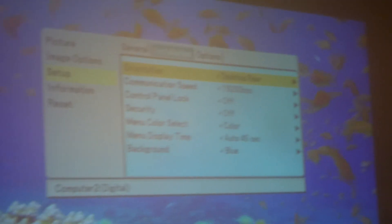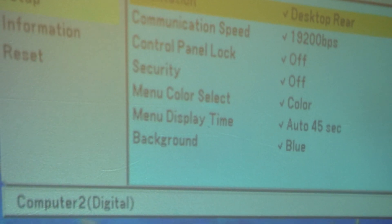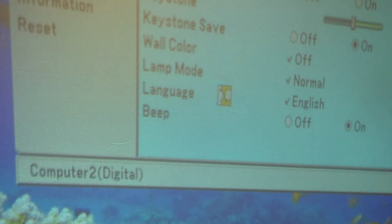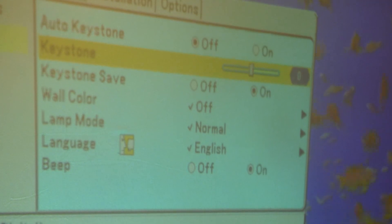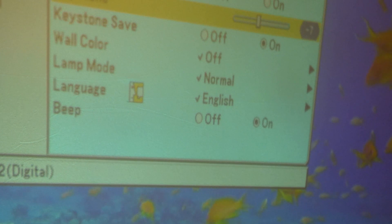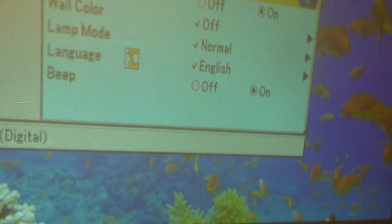Now what you want to do is take your projector and turn it around so it hits the mirror. Then you have it around here and now everything is correct — everything is not in mirror mode anymore. That's not mirror mode anymore. All I have to do now is go over to my settings. We're going to go into keystone. Make sure your automatic keystone is off. From here you want to adjust the picture, so you want to even up the keystone.